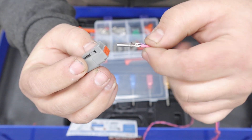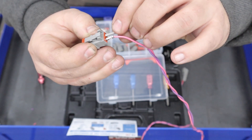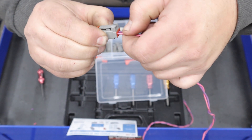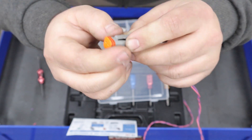The female style crimps are going to go on the other side of the connector — this is called the plug — and they just simply slide through the grommets, just like the other pins, and click into place. They do not need to be rotated a certain way. It is super easy. And then you lock those in place with the orange wedge lock.